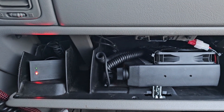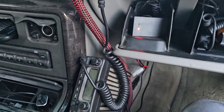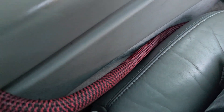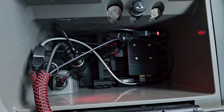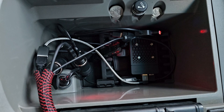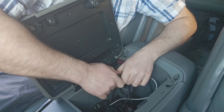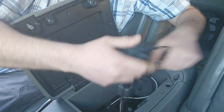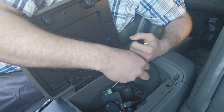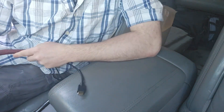This is a big part of my problem: I've got a lot of stuff crammed into small spaces with really long wires connecting everything together — all the way from this monitor down to where I have this cable snaked into the center console to where the Raspberry Pi plugs in. This is an invitation for failure. In fact, the simple act of opening that center console just now created enough static electricity that this system will freeze or crash within the next couple days. I'm willing to bet that cleaning up this mess and shortening these cables will eliminate a lot of the issues I've been seeing. We will now remove the extra organs from the patient. Good riddance — I can have my center console back now.